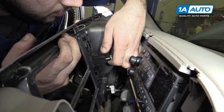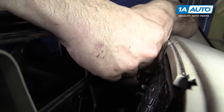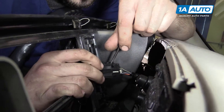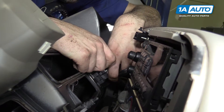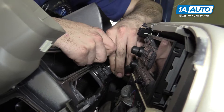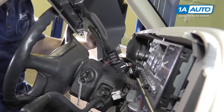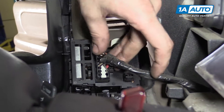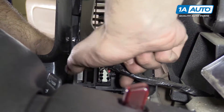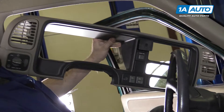We'll then disconnect all of the electrical connectors behind our dash. Now this connector is a little tricky — you have this little T here on the top of the push button. That needs to be depressed to just the right level to sneak it under, and it's almost easier to just use a flat blade screwdriver to pry it down and back. You can then push down and release the connector from the four-wheel drive selector buttons. Flip the panel out and release the headlight switch connector as well. You can now remove the entire dash panel from the vehicle.